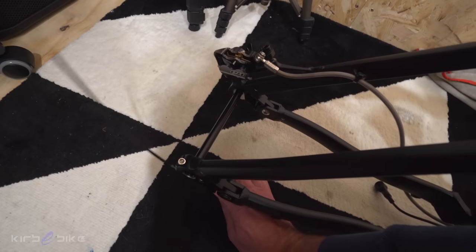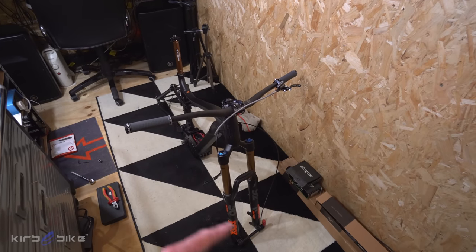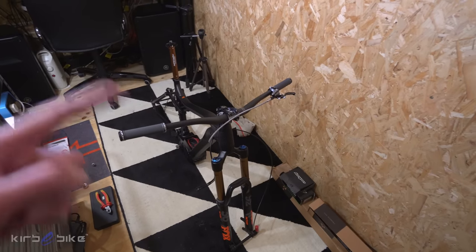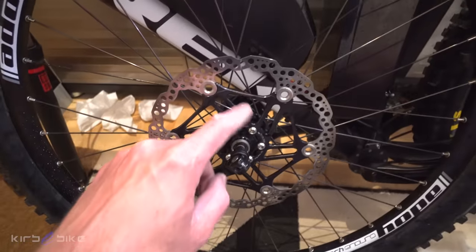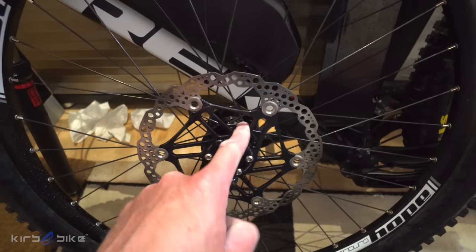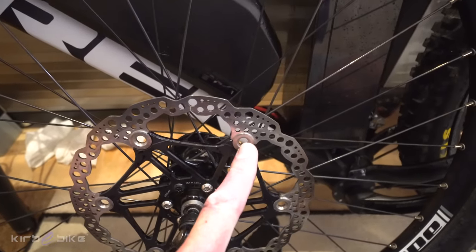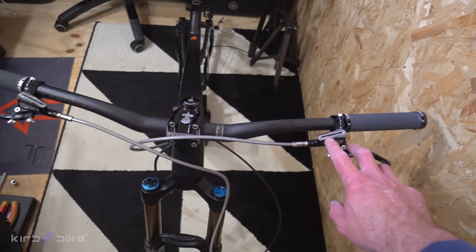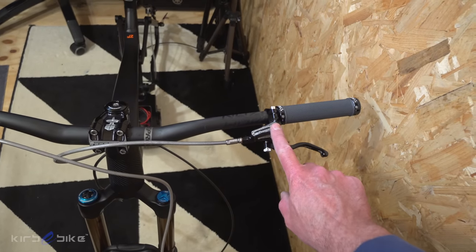The rest of the parts have arrived. I'm going to take the front brake off my Trek — it's got a nice Hope floating brake disc which isn't really necessary on that bike, so I'll put it on this one and get another floating disc for the back to match. We're going all out on this build. These Hope floating discs are absolutely indestructible — you'll never warp one. The only downside is you can only use them with compatible calipers because of the rivets that stick out.